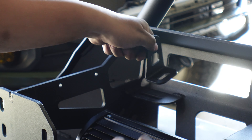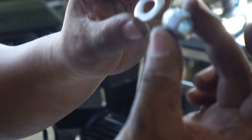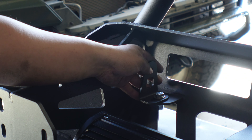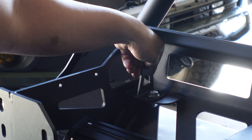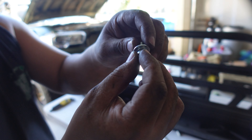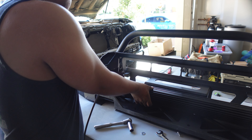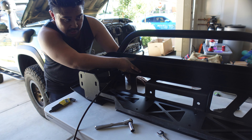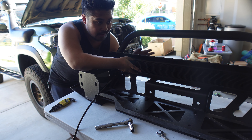Put the bracket on like I was explaining earlier. Take a bolt with a washer and throw that on top, then take a washer and a nut and throw that on the bottom, and ratchet it down until there's just a little bit of play so you can adjust your light bar afterwards. Do that for the other side too. From here, take the screws that look like thumb screws and throw them into your light bar, and attach them to the brackets. Adjust the light bar from the front, make sure it's sitting however you want it, then ratchet it all down. That's the light bar installed — fairly easy.